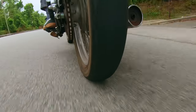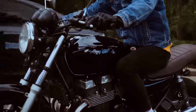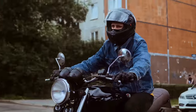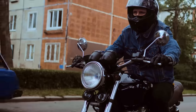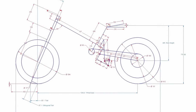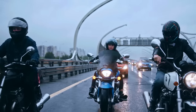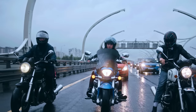A lot of people think that is due to gyroscopic forces produced by spinning wheels. I thought that myself for a long time, but actually it's not true. While gyroscopic forces certainly have their impact, especially at higher speeds, the majority of our bike's stability comes not from them. It comes from the geometrical properties of our bike — specifically the steering geometry, which is described with terms like caster, rake, offset, trail, etc.